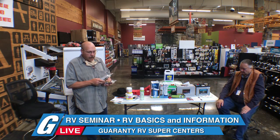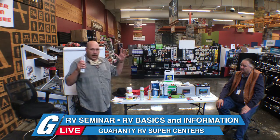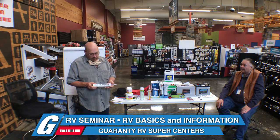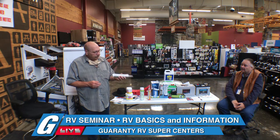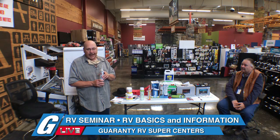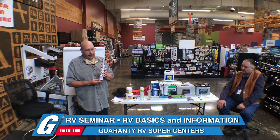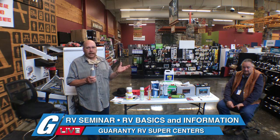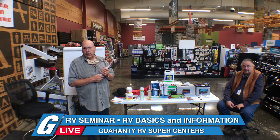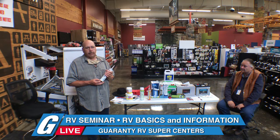We do not use self-leveling Dicor for side sealants around windows or doors — anything on the sides, front, or rear. For those we use ProFlex or Parbon. There are different colors: white, clear, even gray. This is not as drippy but it is twice as sticky, so when you're putting it on, wear gloves. Bathroom caulk, silicone, DAP sealants — that's all household style, it does not work on RVs. Don't let anybody sell you silicone for an RV.